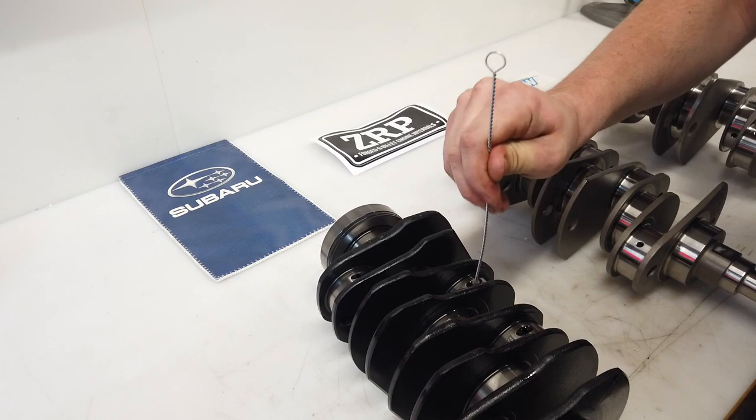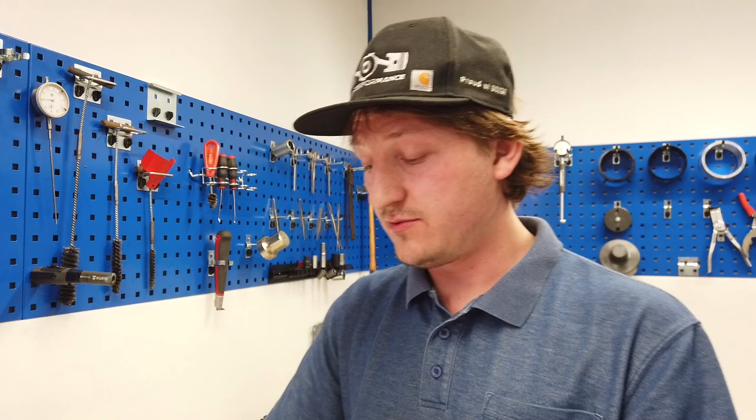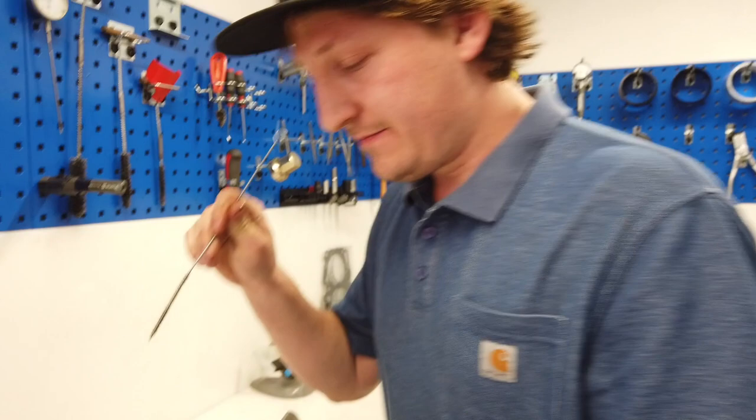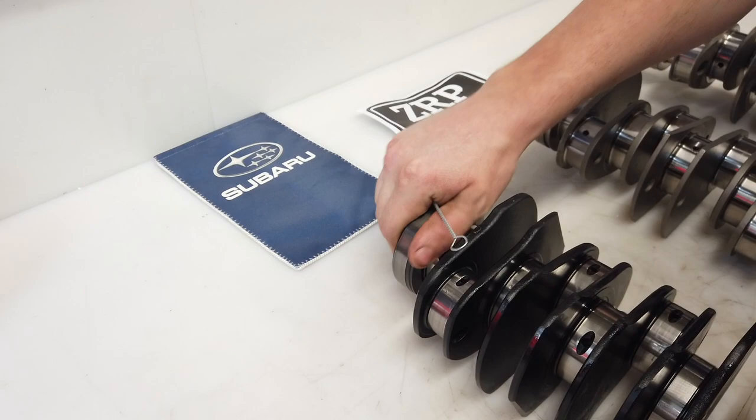The oil flow for the cylinder 2 and cylinder 3 big end bearings comes from only one bearing. So when you have any trouble here, or there's a little bit too much silicone and the flow is bad, you have problems with the big end bearing pretty early, and then you have a knocking noise, and then okay, you know where the problem is. And the same is at the last bearing here. It is like at the front. So that is the original crankshaft.